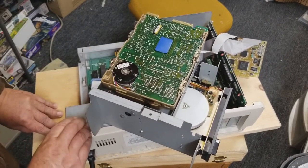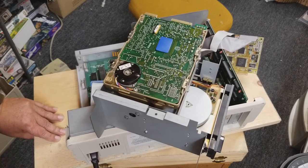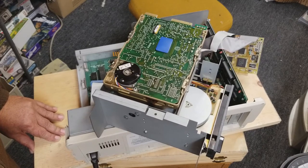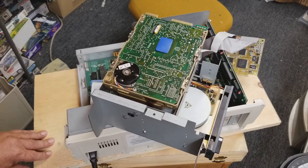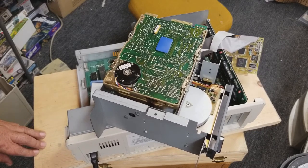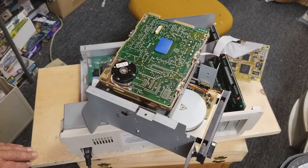Most of the liquid is already seped in, so let's go ahead and turn it on. The spindle motor is turning. I can already tell just by the sound of it that it booted to the C drive. The hard drive came up to speed, did a quick seek, and the stepper motor didn't hesitate or bind like it normally does. It caught the proper FAT table parameters and it booted.